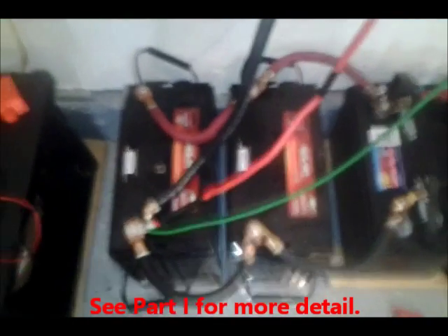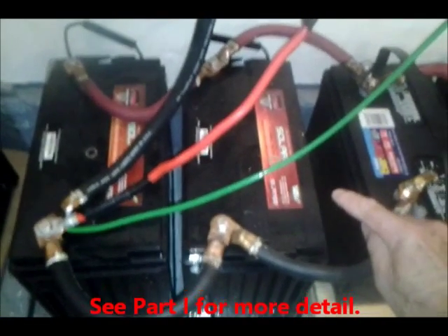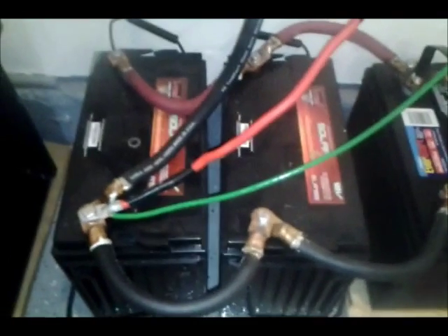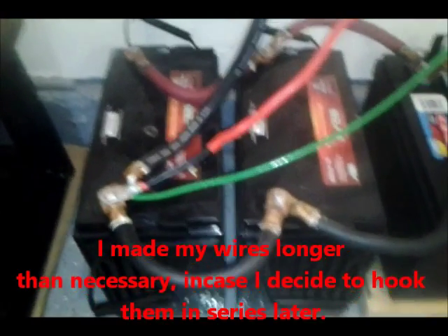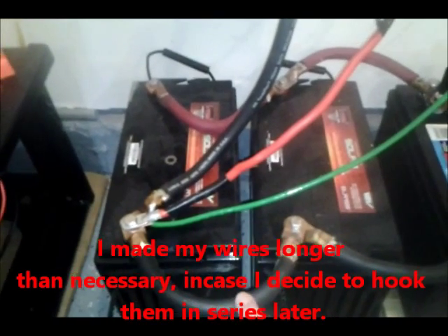Here are the two original batteries. I had VMAX, which are really heavy duty military grade batteries, 155 amp hours. I've changed my cabling to the biggest you can get — welding cable four-aught.